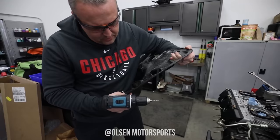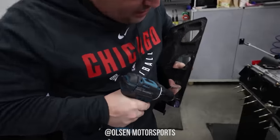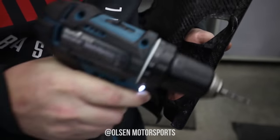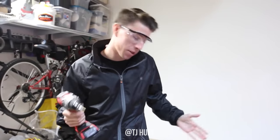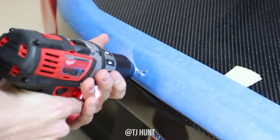Another place that I see this is with the handling of carbon fiber, which can be the ultimate pain in the ass. People constantly have to drill carbon because most carbon pieces don't come pre-drilled. It's normal, but if you don't prep the carbon with the 3x3 tape method and have patience as you gradually increase the drill bit size before tapping it for proper installation, you're also gonna have a bad time. A lot of times they just throw a 6mm bit on that Black & Decker and apply as much pressure to the carbon as they possibly can, and then just pray the next morning, because it ends up cracked, that the seller will accept the return without getting upset or asking further questions. They just want the return.